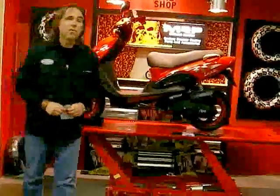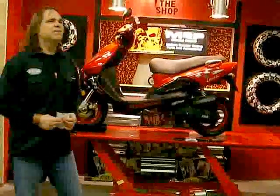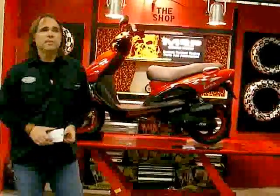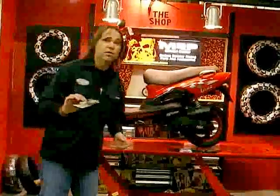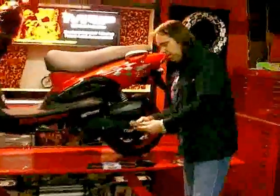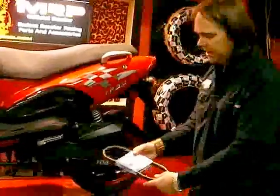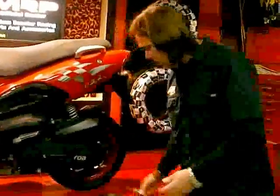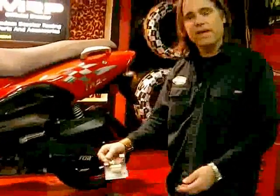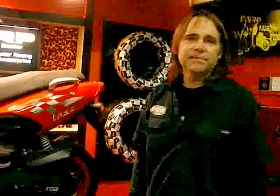Whenever you feel your scooter is losing performance — you've gone 500 to 1,000 miles on your new scooter and it's not doing exactly what it was doing when brand new — most likely your belt is slipping from stretching and your roller weights could be worn. Right in here is your CV transmission. We're going to add the MRP high-performance clutch, a Planini Kevlar belt, and our favorite Dr. Pulley sliding roller weights, which come with the new slider. So you have a complete upgrade for your transmission — keep you up with traffic, get you out of tight situations, keep your speed where you need it. Thanks.